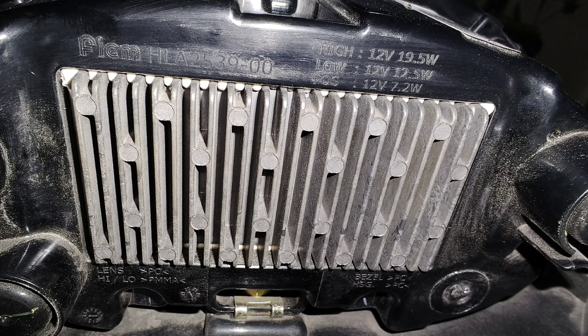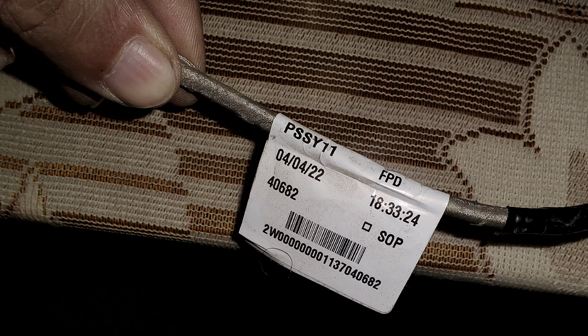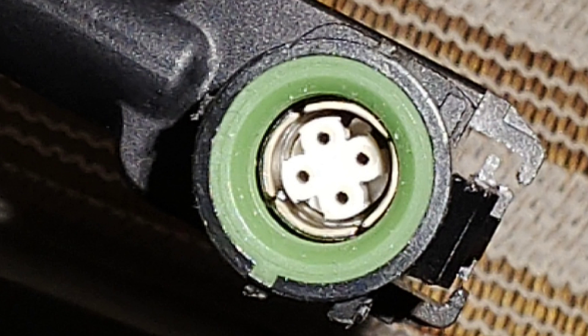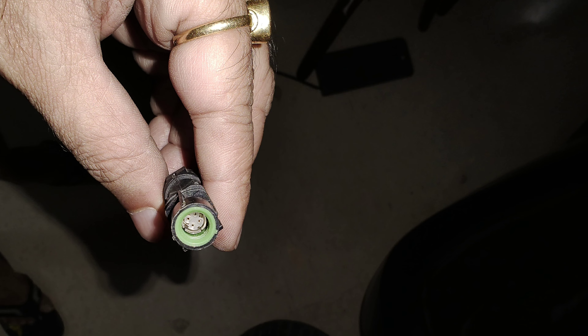We also see the headlight specifications including the manufacturer and lens type. Meanwhile, this is the specification of the FPD cable, which they replace when there is some problem with the GPS. This cable was not replaced when my VCU was replaced for GPS issues. There seem to be four connectors on this cable and a ground connection on the outer core, making it a shielded cable with four conductors inside — likely carrying mobile data and GPS signals.